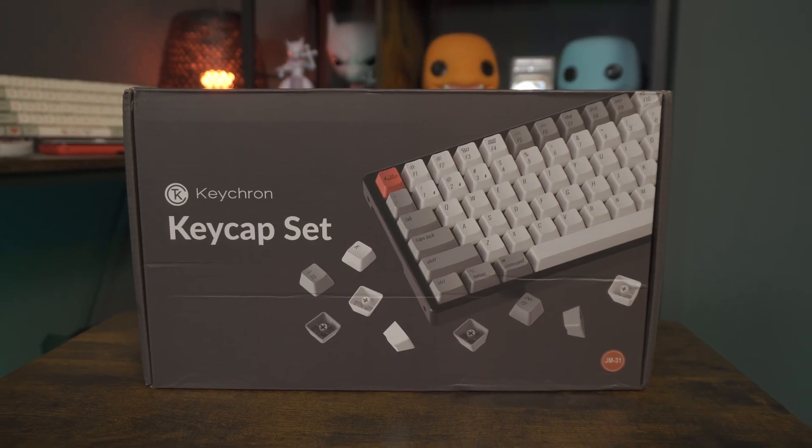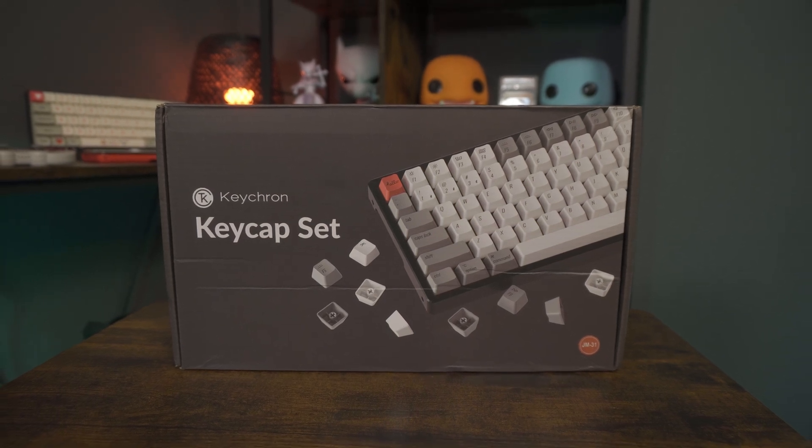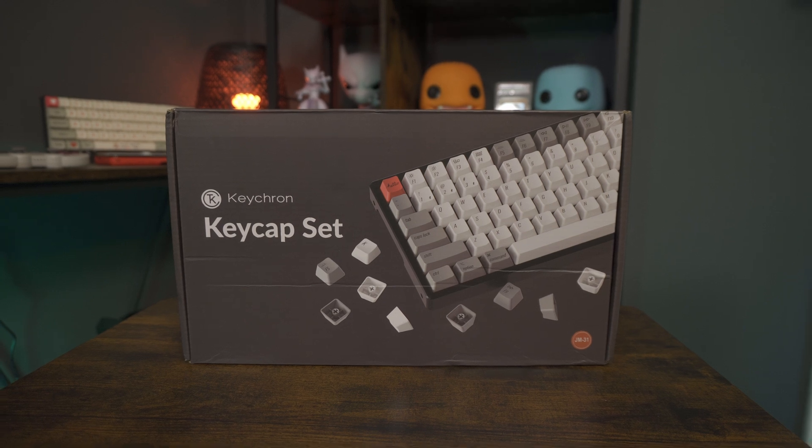The last thing you're going to want is keycaps, and this is where you can let your creativity run free — you can get all the colours, shapes, sizes, different heights, shorter keys, flatter keys, stepped profiles and all kinds of different stuff. This is where you can really make a keyboard look how you want, but it will also affect how it feels to type on. Some profiles such as XDA give you a flat keyboard, whereas OEM profile are taller and stepped between rows so you can feel which row you're on. Once again trying them is the only way to know what you prefer, but the most important thing is the layout. Make sure whatever keycaps you buy have the right layout for whichever keyboard you chose — otherwise you'll have that awkward thing where a UK enter key doesn't fit an American enter key, or your right control button is too big and won't fit, or worse you have gaps.